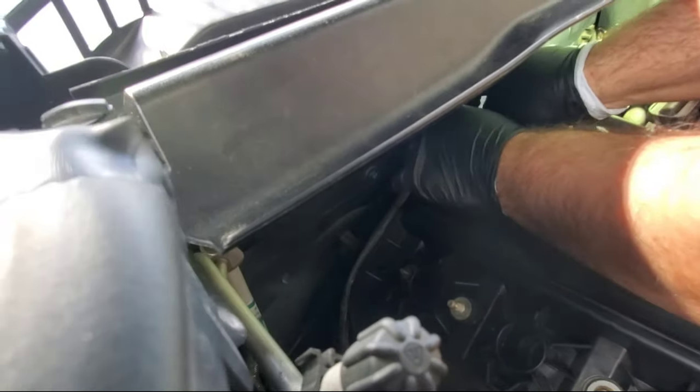For the breather hose or pipe component, dab some motor oil on your finger and lube up the O-ring. Push it back in until you hear it clip into place, then you know it's seated. Then reinstall the small clip into its area. Route the two black wires back through here and run them along, pushing them into the two little clips. Then take the large clip and route both cords through it as you run them down.